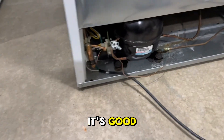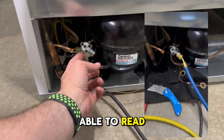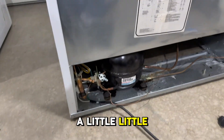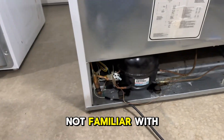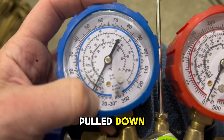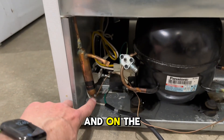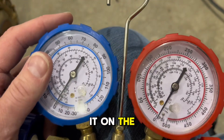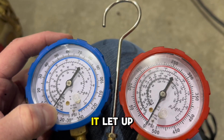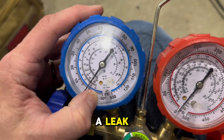The compressor is good, everything on it's good. But when you hook your gauge up to it, it immediately goes negative — pulling down to about negative 25 consistently. When I used heat on the cap tube on the outside it drew down even further, but when I hit the inside with heat it let up a bit and then came right back down. If you shot more freon in thinking there was a leak, it would have crept up but then immediately pulled right back down.